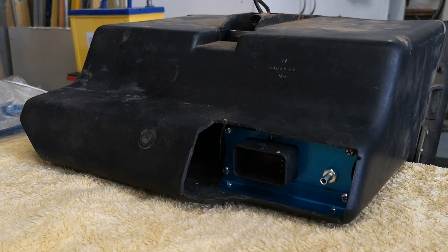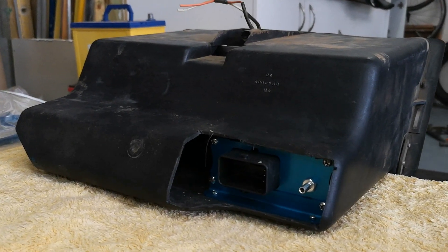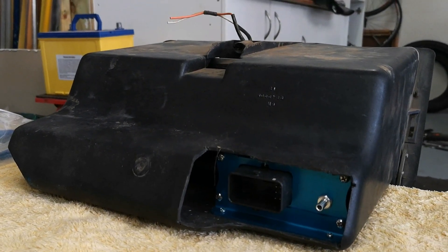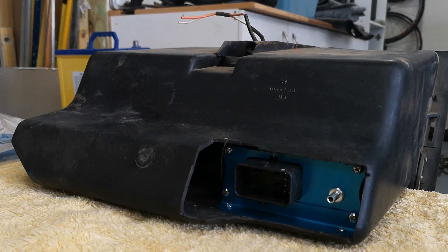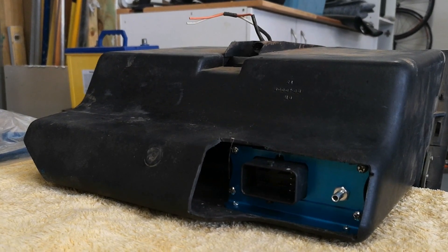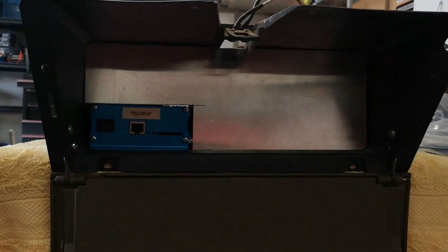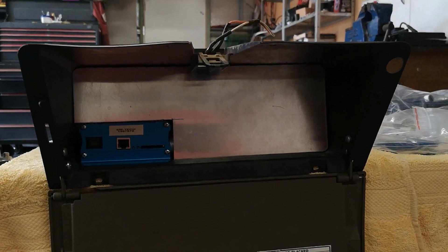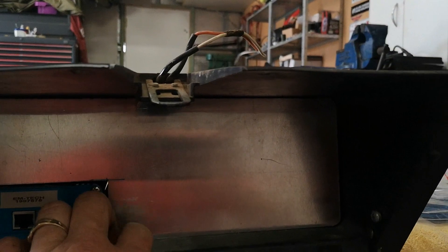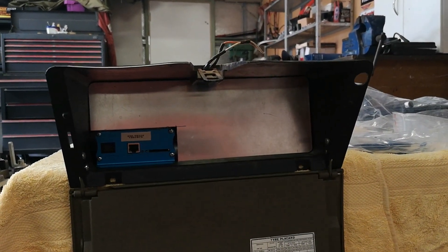I've trimmed out the back corner of the glove box. These are nice glove boxes in the LH/LX — a cardboard fold-up type unit — whereas the UC has a nice plastic glove box, which is really good. I've trimmed out that back corner, made sure the wiring loom attaches there nicely with plenty of clearance for the wires to come out. In the front I've got the connections for accessing the ECU. I've made up an aluminium plate and I'm going to mount up all the relays on it, and put a hole in it for the wires to go through and run back out the back of the glove box.